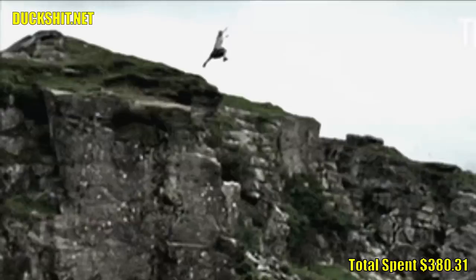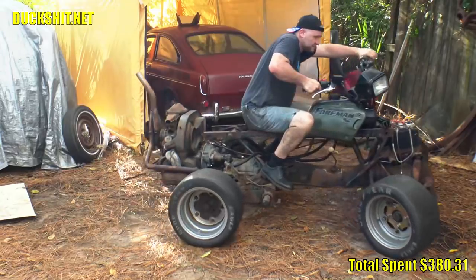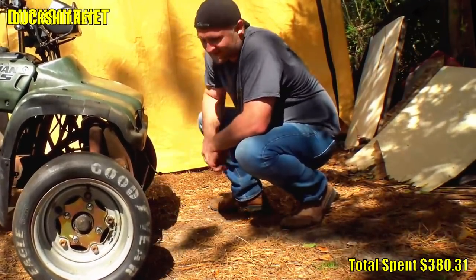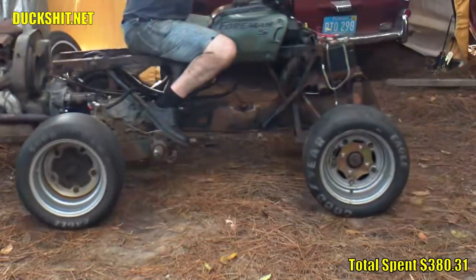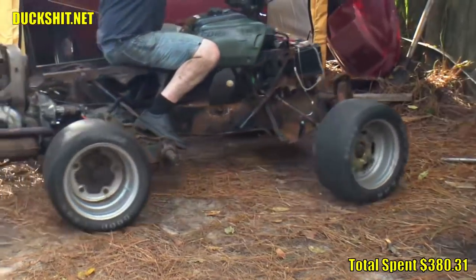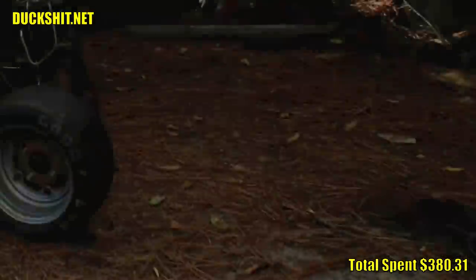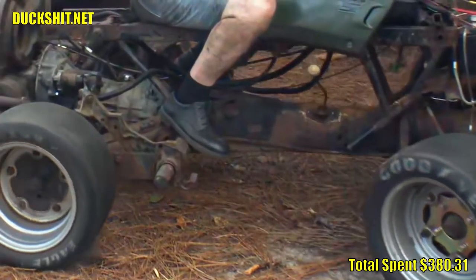I wish I was so sure about things, like my bank account and my dating life. Yes, there was some understeer on my first test ride, but understeer wasn't the cause of the issue — it was the result of a new problem. It was not for the reasons of everyone who just kept telling me the front end is too light. What we had here was actually a compounded combination of problems. The first was that the front calipers kept dragging and sticking — obvious when you watch the extended clips of the test ride. The master cylinder feels fine, but the brakes would sometimes stick or drag badly. The left one was really bad. The second problem is that I'm already riding on slicks on a bed of pine needles, so I might as well just be riding on ice. Those two problems cause the wheels not to roll in the direction they're supposed to — the vehicle just plows the wheels in a straight line, skating over the pine needles like butter sliding across a hot pan.